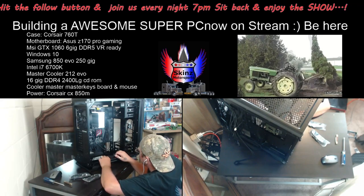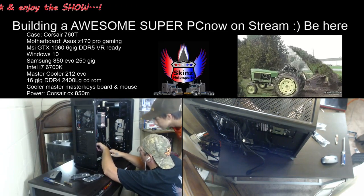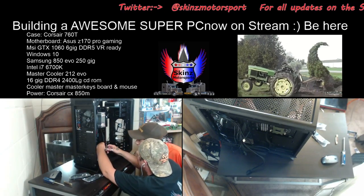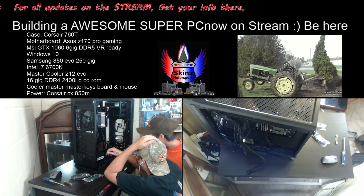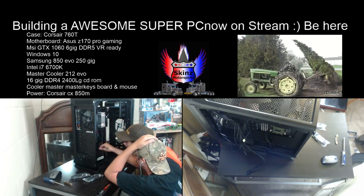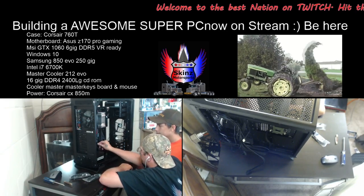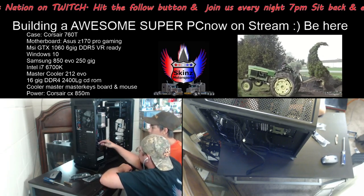Now you're going to have to get your beady little eyes over here because your eyes are better than mine. We want to find out where we're going to plug in all this stuff. What's this first one read? We're looking for HDD LED. How many pins over is that one? 1, 2, 3, 4, 5. It's got HDD underscore LED underscore, so I think 4. The fourth one? Right here? Yeah, that's the last one. Is that where it goes? Guess so.